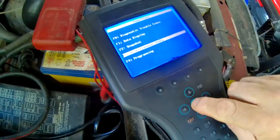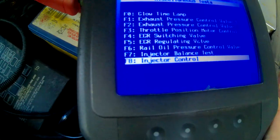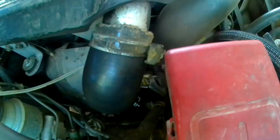At the bottom you can see Injector Control and Injector Balance Test. The first one is Injector Control — this is what we call the click test. What we need to do is press this and listen for clicks. I suspect that injector 1 is the quiet one.